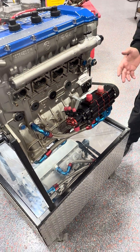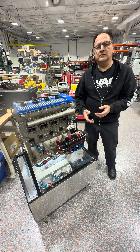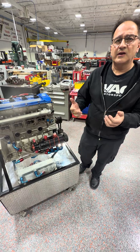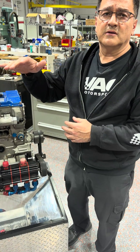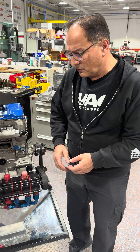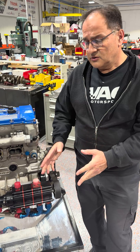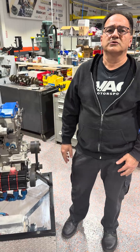The basic layout of a dry sump pump and the benefits of it is that you have constant oil pressure. It's belt driven and you can control your capacity. Most tanks that we run are three to four gallon tanks and they're usually 50% to 75% filled. Therefore you have really good capacity, good lubrication, good positive lubrication. You can control your pressure and control the life of your engine. Dry sumps, when the rules allow, are the way to go — it's the best insurance for your engine.